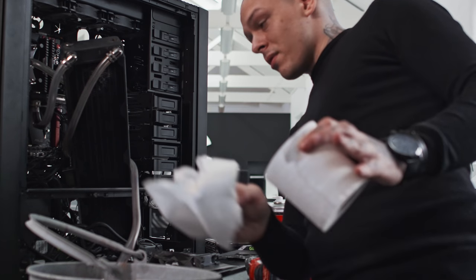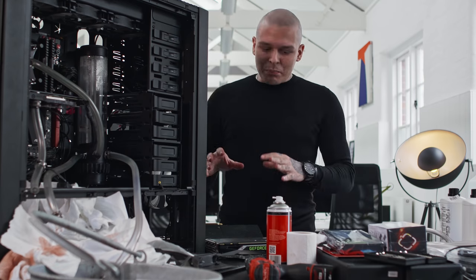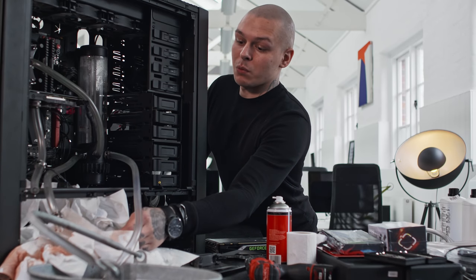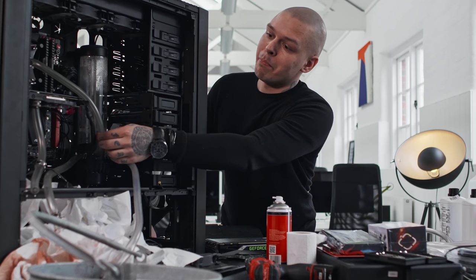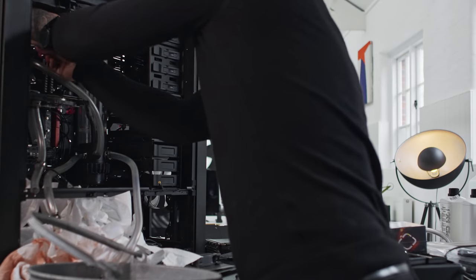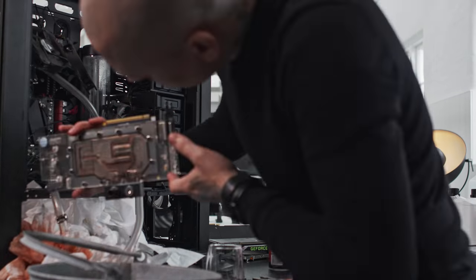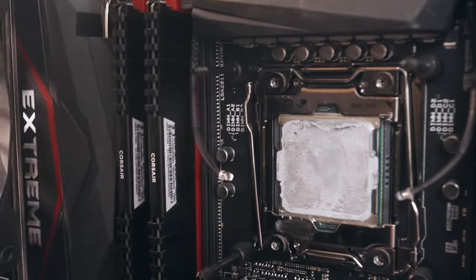To make sure everything is safe, I'll put a lot of tissues around. The process looks really messy, but the result will look neat and nice. At the moment it looks like I killed someone, because I used to have a red liquid in it. Because I didn't maintain the station regularly, my clear tubes got kind of a beige color. I want to replace them all to have a really clean look. I'll disassemble the water cooled 1070 and all the pipes, plus the top radiator.